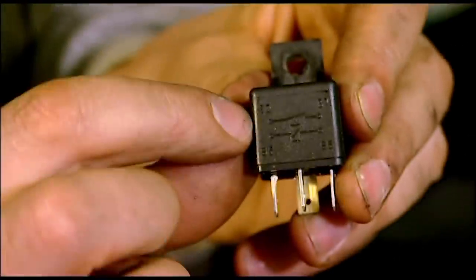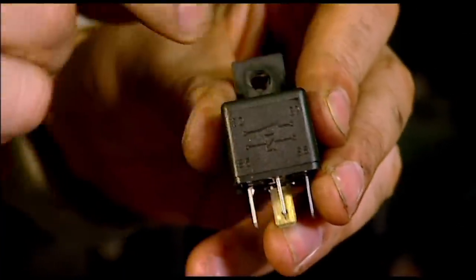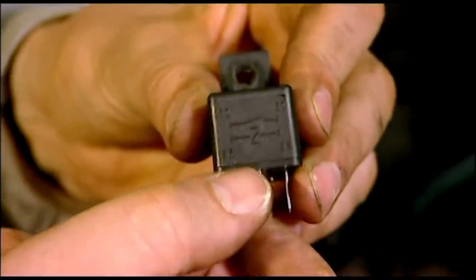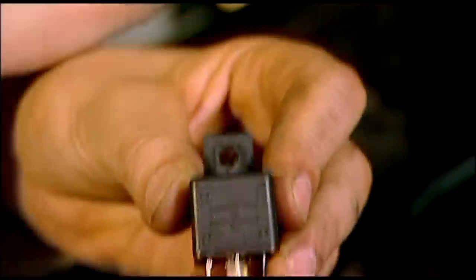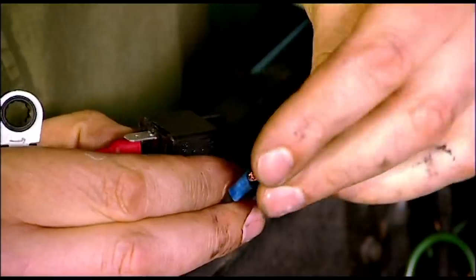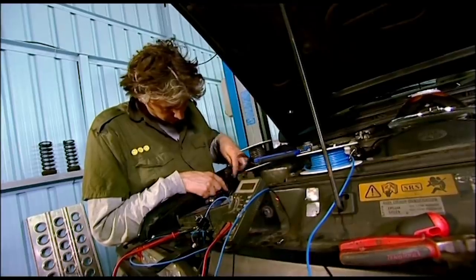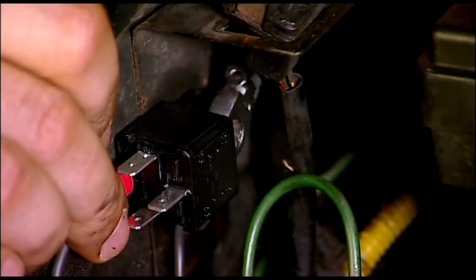You can see on the relay there's a little diagram. A relay is just really an automated way of turning a switch on and off. That little square blob is basically an electromagnet that you energise with a smaller signal, so you can turn on a big powerful thing like spotlights with a small amount of current, and then it takes the big current directly from the battery. I'm going to run a high current wire from the battery to the switch side of the relay and then from the relay to the spotlights. These will be operated when the main beam takeoff I found earlier energises the low current side of the relay. First I'm attaching the relay to the engine bay and using the mounting screw to connect the earth for the relay to the chassis. When I flick the main beam the relay will be energised and will allow the current to flow through the high current wire to the spotlights.